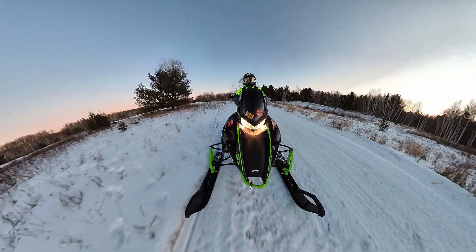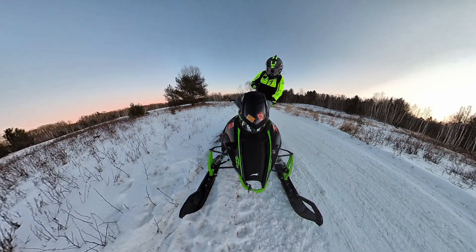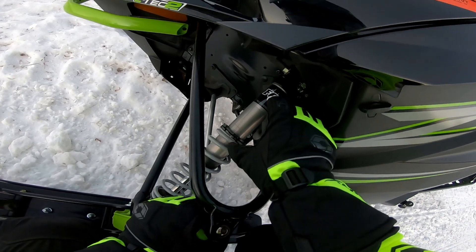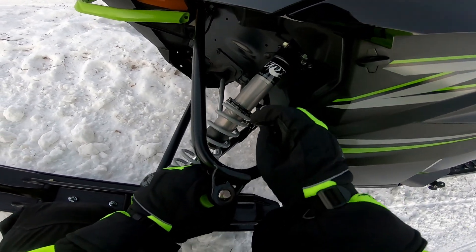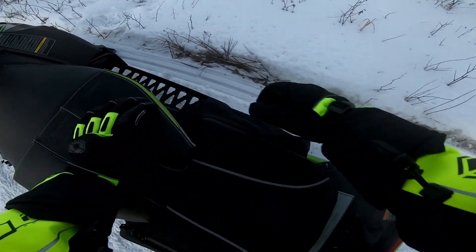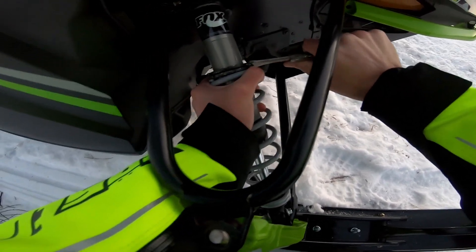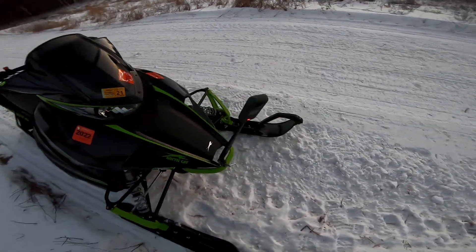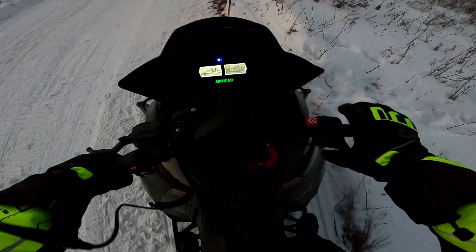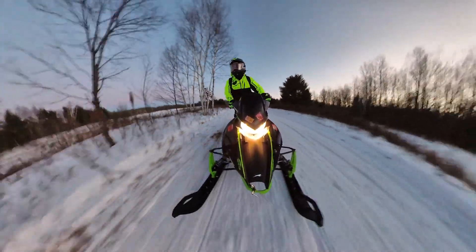This spot looks familiar and since we haven't got any snow since last time, I can tell it's the same spot I adjusted them last time — here are my tracks. I won't bore you guys with this but I'll show you quickly what I'm going to do. We've got quite a bit of relief I can take off the springs, and not a whole lot of preload left. I had these quite a ways down so I'm going to back those off quite a bit. That's about as even as we're going to get — measuring with a keychain! Beautiful night to be laying on the side of the trail adjusting suspension.